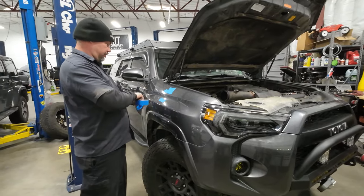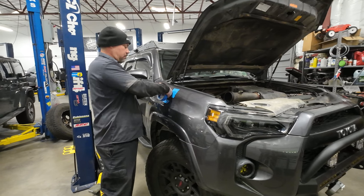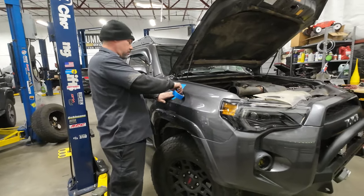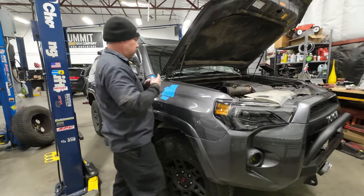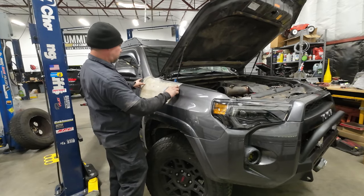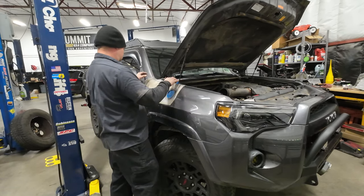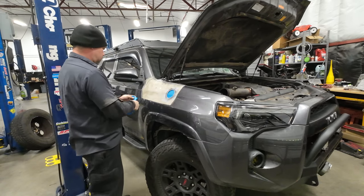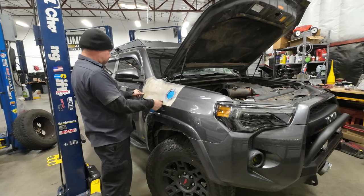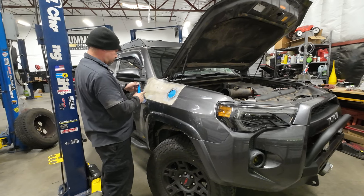He did make note that as cool as the snorkel is, there was a small issue with the template, and he had to make a few tweaks to make it perfect. Jeff had already removed the factory airbox to make room for the feed tube. Once the template was all squared away, he did a test fit, made sure it was perfect, and then he started to put some blue tape behind the holes — behind the large hole where the feed tube will go, and behind the four bolt holes as well. That tape serves as a backing, so when he marks the holes through the template, he knows exactly where to drill once he removes the template.